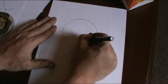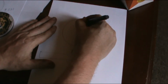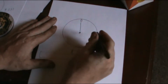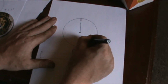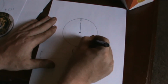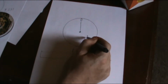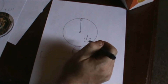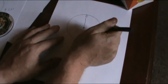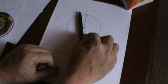There are 2 needles that you have to worry about. There is the main needle, which you're going to want to get relatively close to 0. It doesn't matter if it's perfectly on 0. This turns a little bit, but you want to get it close to 0. But there's also one right here that goes 0, 1, 2, 3, 4, and then this is 5 again. That's got a 1/2 inch sweep. That's why it comes back to 5. You're going to want to get that on 0. Okay, focus whenever you're trying to set your needle here and your depth checker. In my case, it was a 3-inch. You're going to want to try to set this one to 0. If you're off just a little bit, it'll be fine, but you want to be able to read this one as 0.